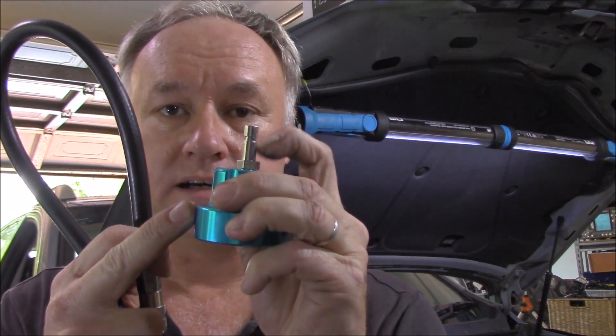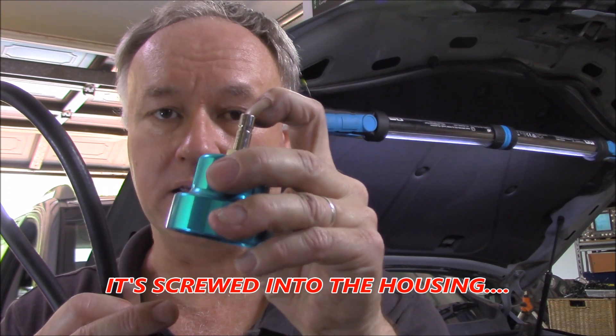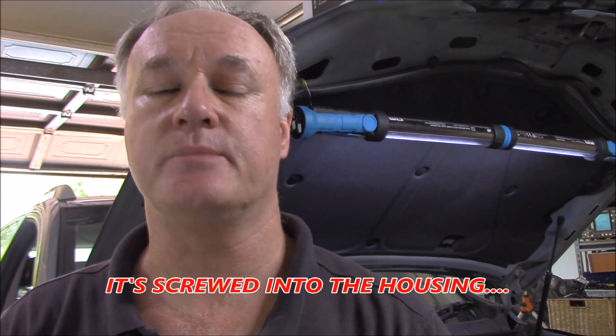The brand that I have is a Repco coolant pressure tester with this sort of attachment to it. What I've done is pulled out this bleeder here and I'm now going to attach that to my pressure differential sensor, and then I can pump up to whatever pressure I want and see if the scan tool will read the same measurement. That way it will prove the integrity of the sensor itself. All that I've done is remove the actual nipple assembly out of the top of one of these adapters.